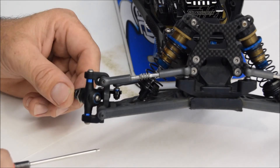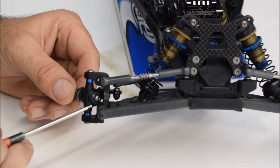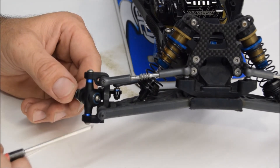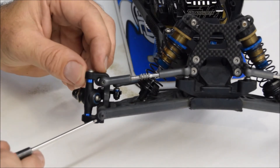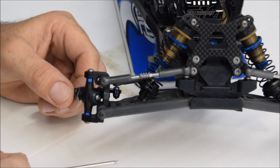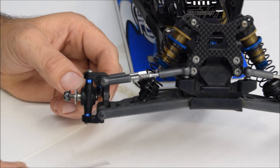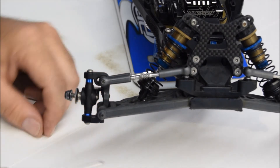What we're working with here is the front spindle and carrier. As you can see, the axle goes through the spindle and is worn, where it attaches to the carrier is worn, the ball cup, where it attaches to the arm, and then the shock. That affects everything in the steering. It affects the camber. It affects how it goes through bumps. It affects everything handling. So obviously this is a big part of the car.